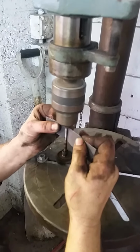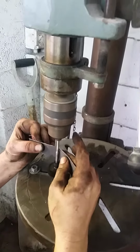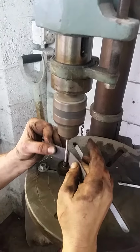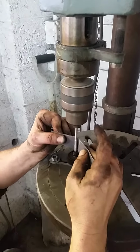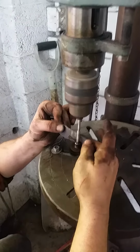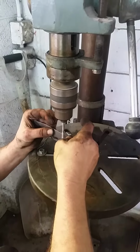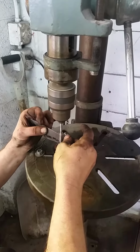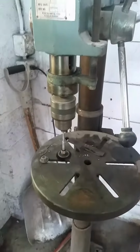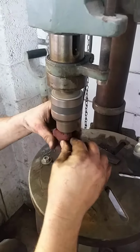That shaft has to be 100% straight. We don't want any bending or anything, so he's just going to apply light pressure to it. If you bend it, you're buying a new turbo. That's all there is to it. I'm going to take some Scotch-Brite after we took a little bit of sandpaper to it.